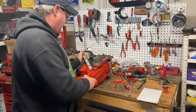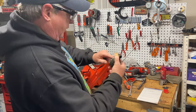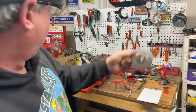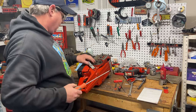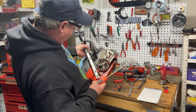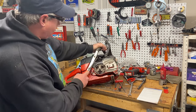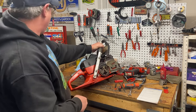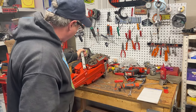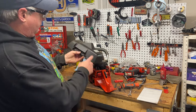You can see the damage — part of it has been broken off, maybe from someone grinding on it or beating on it. Never hit the end of that crankshaft; you'll break the area where the clip goes on. The drum appears to be in one piece, but it's pitted — the hard surfacing has come off and it needs to be replaced. The clutch is in good shape, it's the three-spring type, very bulletproof on Huskies and Jonsered — not like Stihl's tiny spring ones, which are terrible. The decompression button is broken off but still in there.